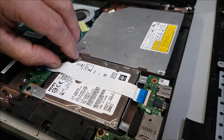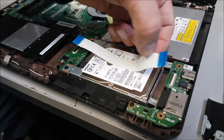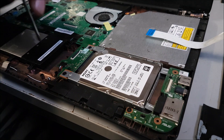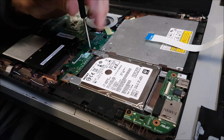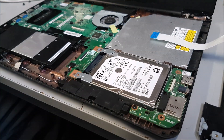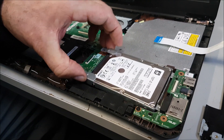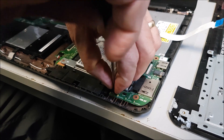So we can get the hard drive, because it looks like it's stuck. I'm going to pull it off anyway because we've got to change the hard drive. You don't want to damage the ribbon — that's scary. So we unscrew that, we unscrew this. They're not going to slide backwards like that, and then up she comes, gently does it, because you're sliding underneath electronic boards. I have to undo that circuit board screw.